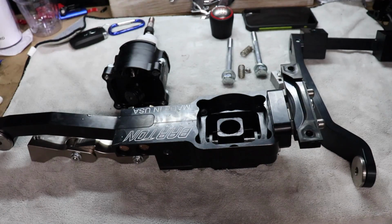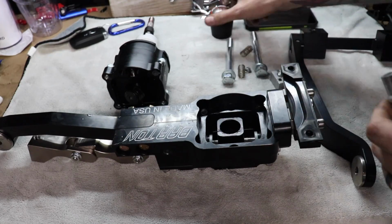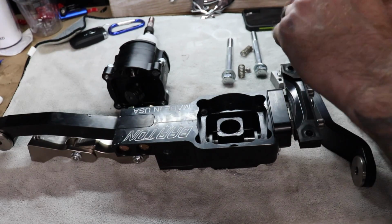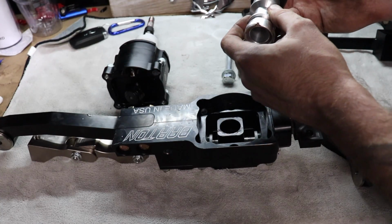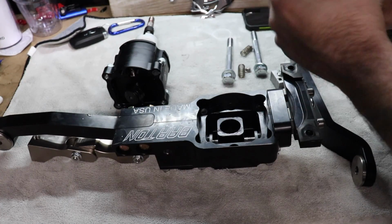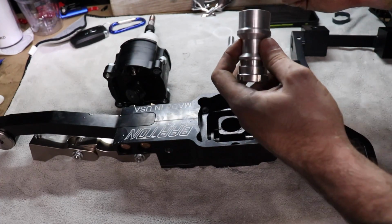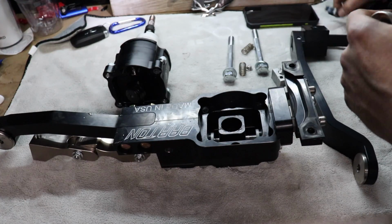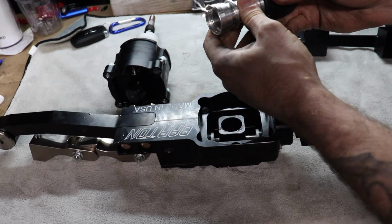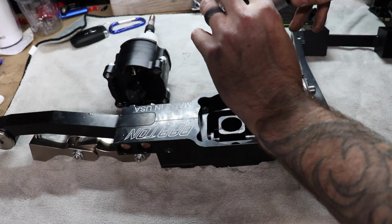So also the Barton. It's great that it comes with all of this stuff. It does come with this as well. It's very nice. It's got the O-ring inside and everything. If you plan on running the GT350 knob that's rethreaded for our transmissions, it does not fit. So there is this little piece inside there you got to take out. But anyway, if you plan on running a 350 knob, it does go in with that little retaining clip out, but it's a very snug fit, and it doesn't allow the reverse lockout spring to pull it down. You kind of have to force it.